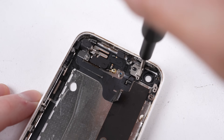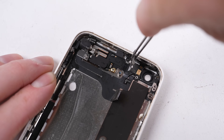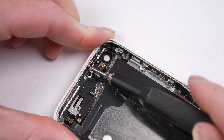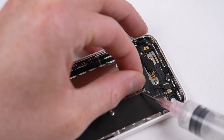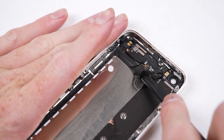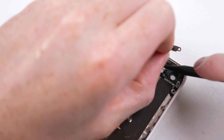But we're not done with this 5C yet. The flex cable for the buttons has a different connector than the SE board which will go in here, so if we're going to have working buttons, we must replace it. One difference between the two phones is the positioning of the vibration motor, so I'm hoping to be able to reuse the original one. Now that all the screws are removed, the flex cable can come free with the aid of some alcohol.